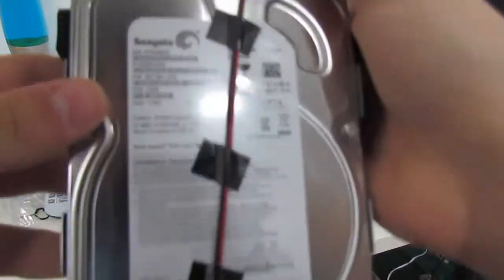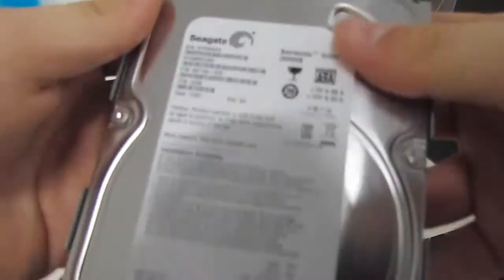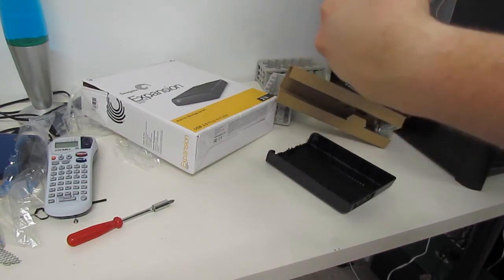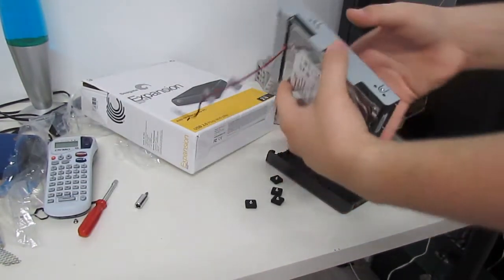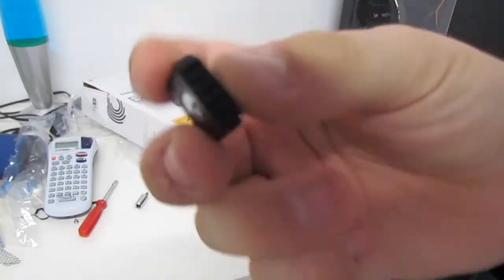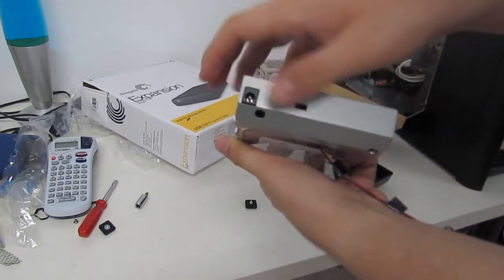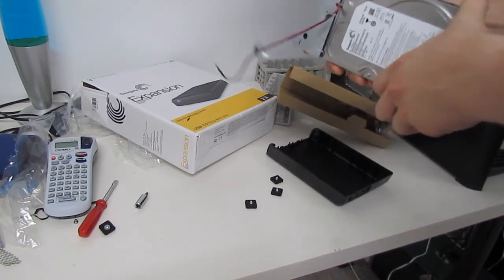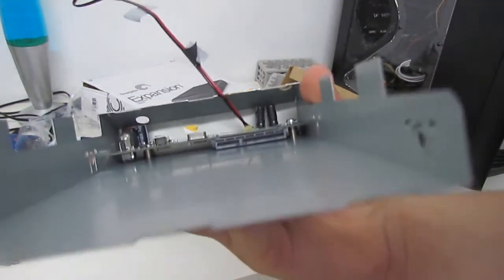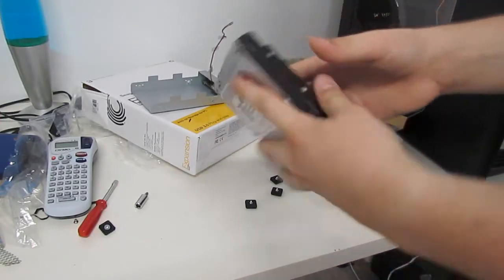Let's have a look at what's actually inside. We can get this stuff off, get the LED off. And what do we have here? Yeah, we have a green 5900 RPM drive. So now that I have this drive, I'll actually unscrew it first. The screws are located there, there, there and there — very small, so you shouldn't have any trouble getting them off. Now I can take the drive out. You'll notice it's still connected to the bay via USB, but you can pretty much just pull it straight out — it's just connected by SATA power and data connectors. It might require a little bit of force, but don't worry, you won't break the drive.